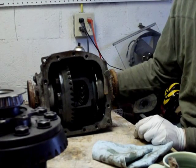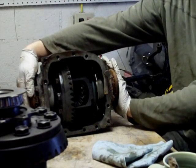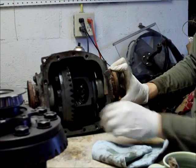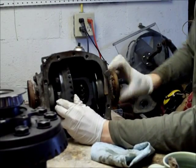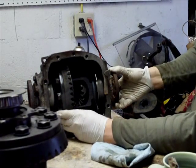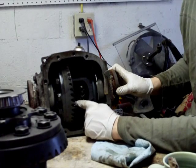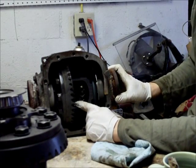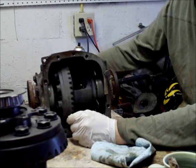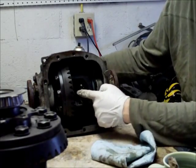The only time it's different is when there's a torque difference between the two rear wheels. If I spin one side, the other axle stub will actually spin the opposite direction. That's the only time you'll see these spider gears in the middle move. So under regular operation, absolutely no action here in the center spider gears.